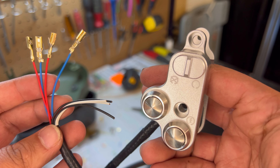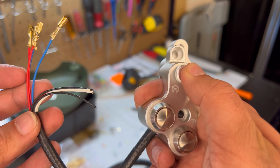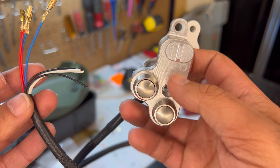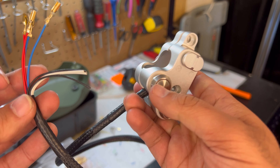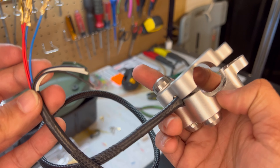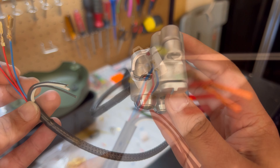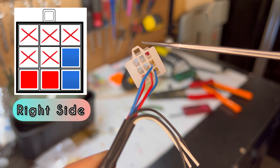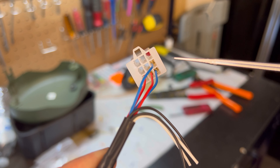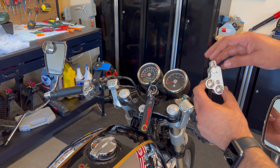For the right side it's actually really simple - we only need four wires. The red wires are for the kill switch, and then blue is for the ignition which actually triggers the starter. A benefit of this is you technically have two switches that you could mount accessories to - you could run lights, a USB phone charger, anything like that. For the right side, with the tab at the top, your red will go bottom left, blue middle and bottom right. Pretty simple - I'm going to wrap these with some electrical tape.